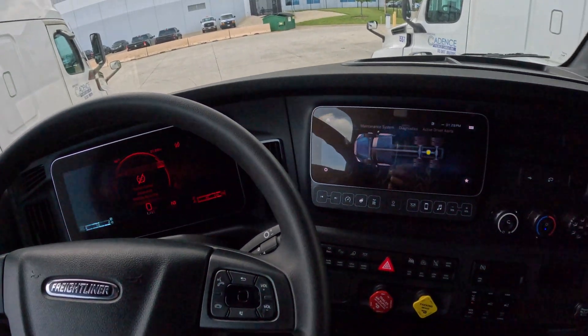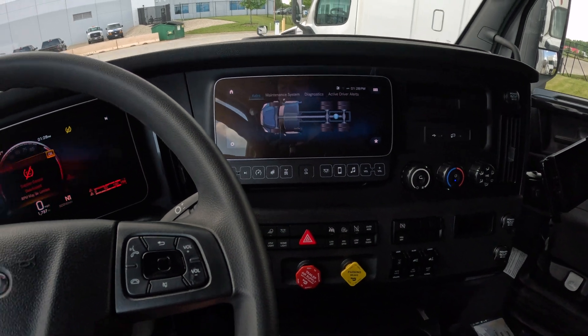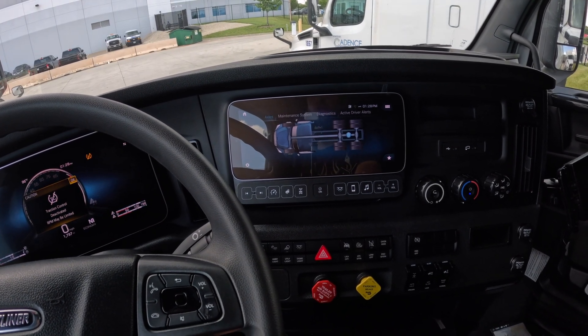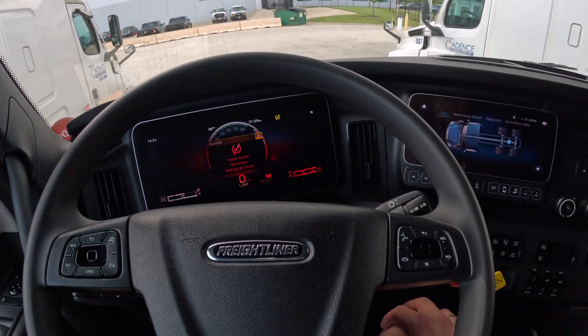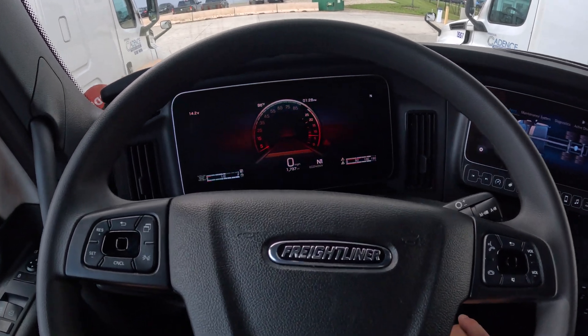After you get out of the uncomfortable situation, you should never drive with axles locked up — you can damage the differential and tires. So disengage the axle lock and it will go back to blue. Make sure you always unlock it after use. Since we disconnected our traction controls, simply reconnect them. Now there are no more warning lights on the dashboard — we're out of the situation. I hope this helped! Please press like, subscribe to my channel, and leave any comments you have.